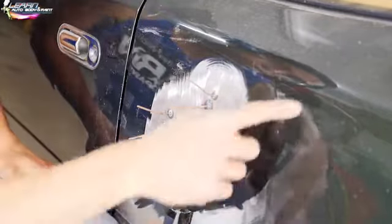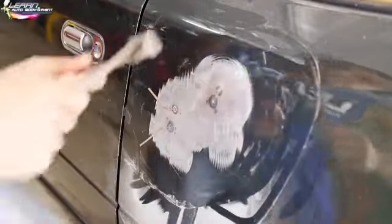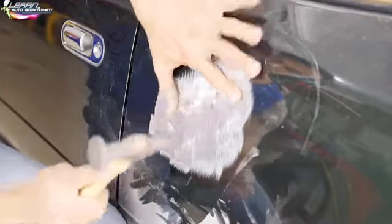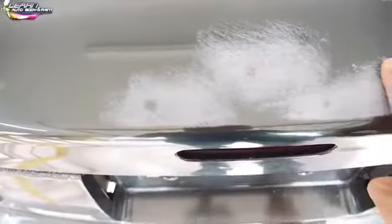80 grit around this whole area. You push them down so you can get to them, cut any turn and it comes right off. If you see a metal spot coming through to your Bondo, you just want to hit that spot down a little bit. I used the 80 grit DA and sanded — now what you see here are all the low spots.